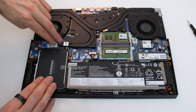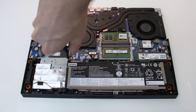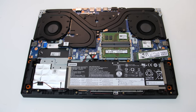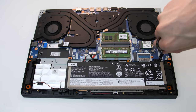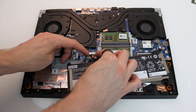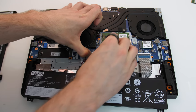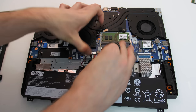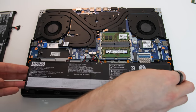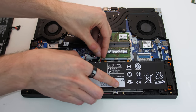To get the smaller battery out you need to first remove the 2.5 inch drive tray, then there are three more Phillips head screws holding the battery in — one is hiding under the M.2 SSD that the laptop ships with, so you'll have to temporarily remove the SSD to remove the battery. I removed the battery cable using my fingernails on both sides simultaneously and pulling. Putting the new 80Wh battery in is basically the same process in reverse: connect the cable, put the battery in place, then screw it in. You'll need to use some of the screws that were holding the 2.5 inch drive tray, then don't forget to put the M.2 SSD back in afterwards.